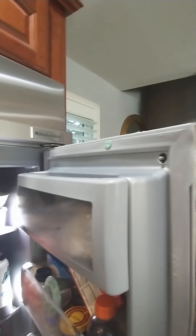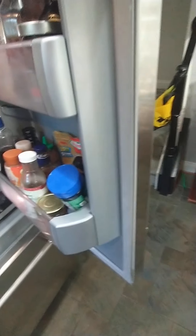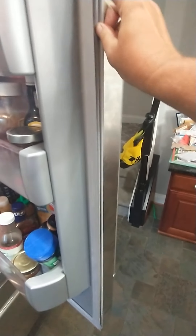I looked at the polarity of the magnets that are in the door frame and in the seal, and the polarity has reversed on the door — so the magnet actually pushes the door out from the frame. I looked on the parts listings for KitchenAid and KitchenAid no longer makes this rubber seal — it's a discontinued item.